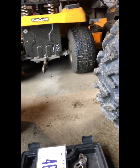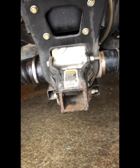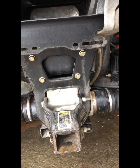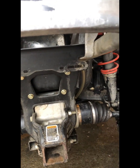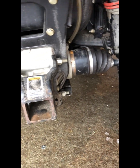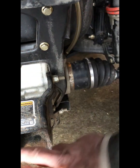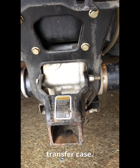Today's task is to put a winch on the back of the ATV. I had originally bought a two-and-a-half-inch plate that the winch would be mounted to, which would also allow me to keep a normal hitch attached to it. But the more I read, the more I saw a weakness — if you put too much pressure on it, you can see it's attached to the transfer case here, and this ends up cracking and costing a lot of money to replace.